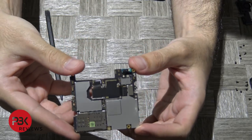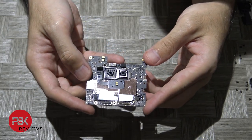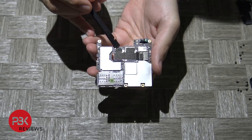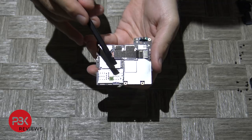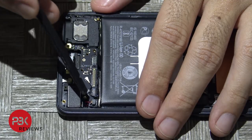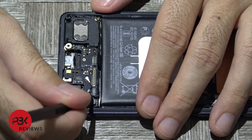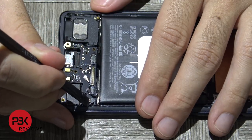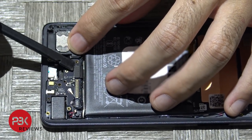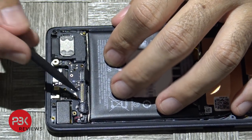Here's your main board. On the back of the board you have your main camera connector — one over here and one over here. And you have your memory card and SIM tray and SIM reader right here. Over here you have the connector for the vibrator, which is right here — you're going to have to pop it off, just pull it down away from this connector. Next you have another connector down here — pop this connector up and disconnect this cable over here.